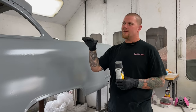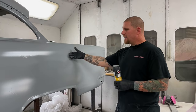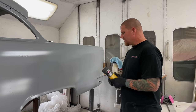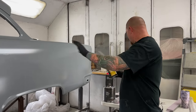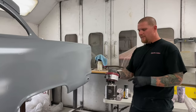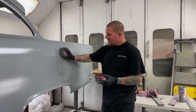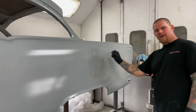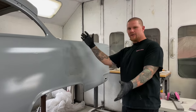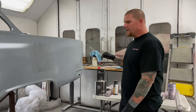Every little nook and cranny needs to be covered to make sure you don't have any lows. The guide coat is going to show you where your lows are in the body working stage of the primer, so be sure to use the correct product and cover the whole car evenly. The reason that we don't use the powder in this stage is because of the sheen — it really does not stick. It puts such a light coat you can't even really see it, and that's why I like to use it initially with the spray. After you get through that very top coat that has the sheen and it's now dulled out, powder is the way to go. It's a lot easier to sand and doesn't clog your paper.